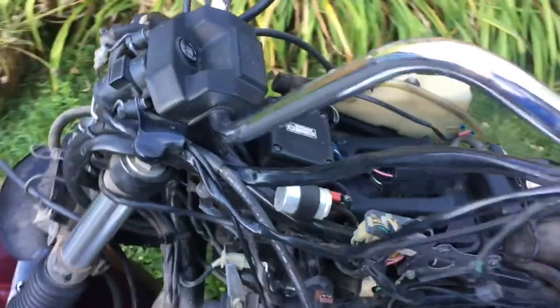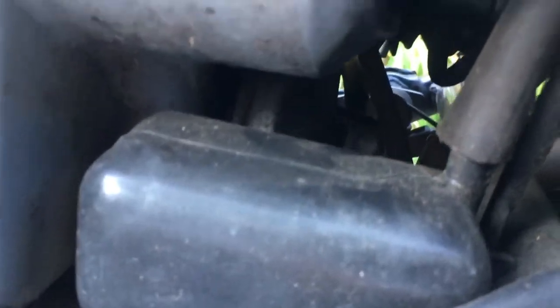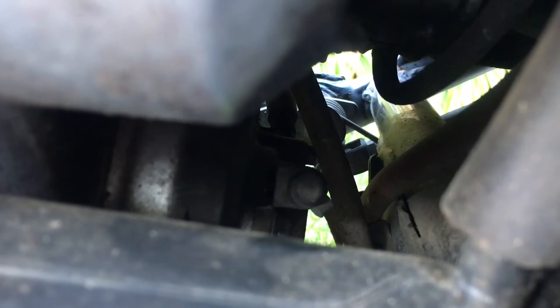The clutch lever is missing but we do have the clutch hose. The clutch is buried down in here - right in there you can see where you would bleed it; there's a bleeder. So the clutch is there, except you can't build pressure because there's no master cylinder and no lever. Right in there is your slave cylinder for the clutch.